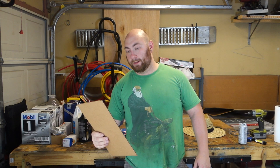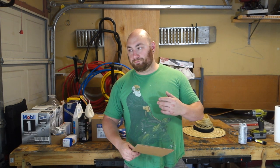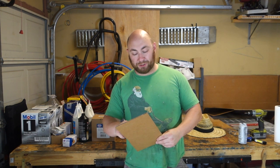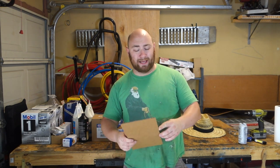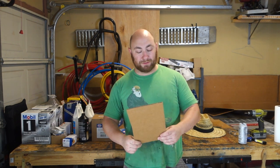We're gonna do an oil change, flush the transmission fluid, put on a new transmission pan and a new transmission filter. We're going to install a Corvette servo to give us a firmer shift — it's cheap, like $15, and it's super easy to do while you're in there. We're gonna put on a new air filter, rip on a new blower motor so you have air blowing inside the cab properly, flush and bleed the brakes — which gives us a chance to inspect the brake pads and shoes. We're gonna put new gear oil and a new gasket on the front diff and rear diff, install a new fuel filter, new spark plugs, fix the window switches for power windows and locks, and flush the fluid in the transfer case.